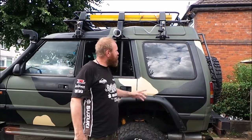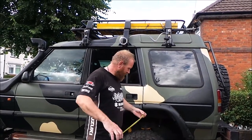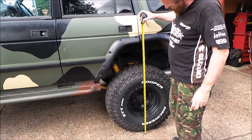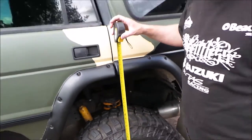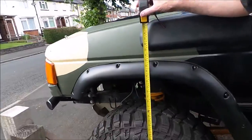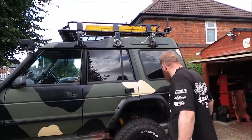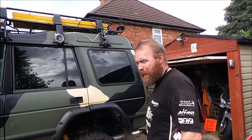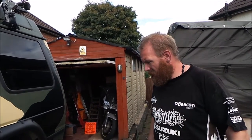Right then, as I said it's all done. Just for height - I'm six foot two so it's getting bigger. To the top of the arch: 45 and a half inches at the rear, 42 and a half inches at the front. The tyres won't fall any further now. I've got a little bit more suspension back on the bottom end. So we'll call this a success - that's the two-inch lift blocks done.